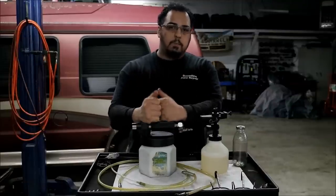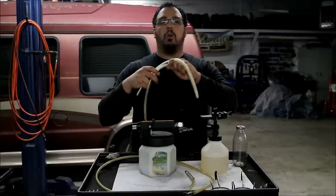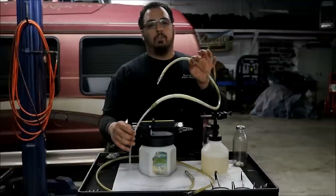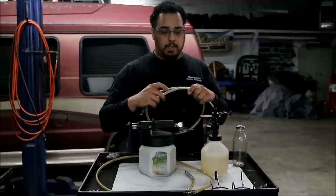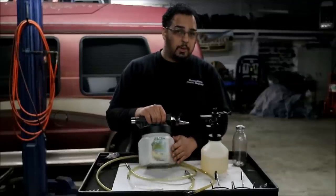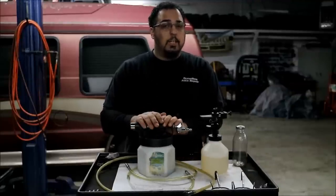You can also use this pump to suck out fluid from the master cylinder if you're doing a brake flush. There are small hose attachments you can stick inside the master cylinder to suck all the old fluid out, along with any dirt and grime. Just pay attention to how full the collection bottle gets — once it's completely filled it won't suck anymore.